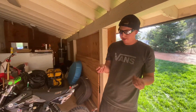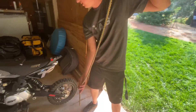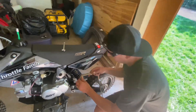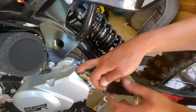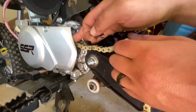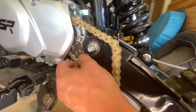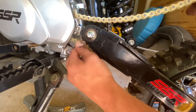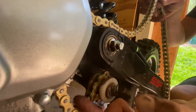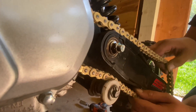The reason you need to cut the smaller side is because I'm going to show you right here how this works. This is the master link and I'm going to slide this right here onto the bike. This helps a lot when it's in neutral — you can slide it up in here and it should come out down around the bottom. You want to make sure it flows in the normal rotation of how everything goes. Grab this, put it over here on the chain guide, and then slide it down through your other chain guide.